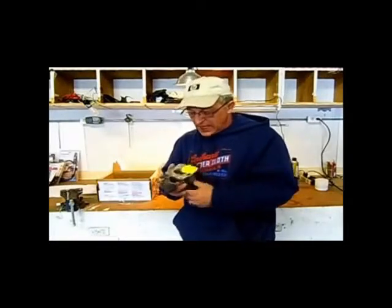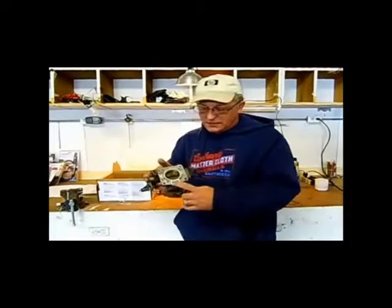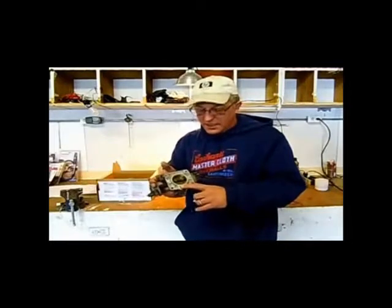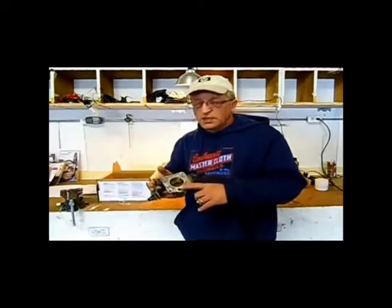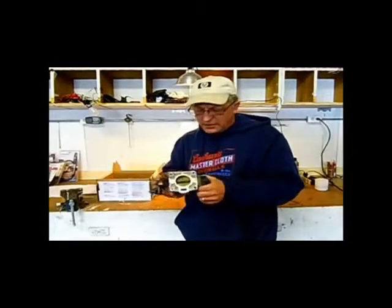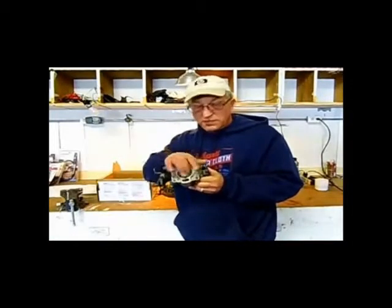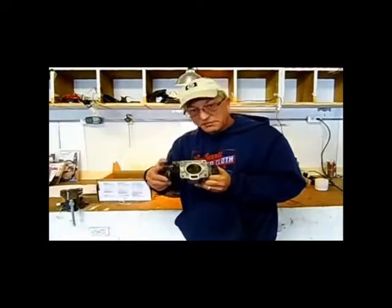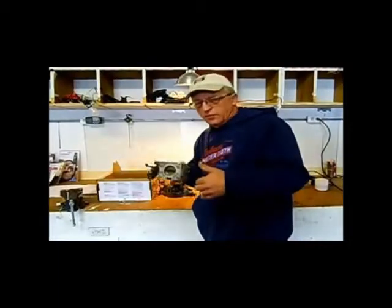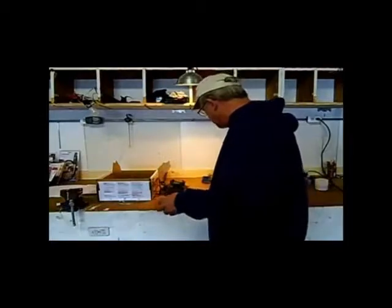Now, once again, on the back side, this is what you'll be looking at. This is the idle air pathway. It goes through a channel on the intake manifold. A lot of them vent right into the throttle body, or they manage it through a valve on the outside of the engine. But the groove just goes in the area that turns toward the engine. It goes in the throttle body where the plate is closest to the engine, so that the plate will move over the groove. It's the same in every engine. Some imports in the 90s have computer-controlled throttle bodies, but that was the next advance that hit the U.S. market.